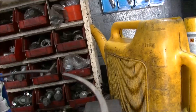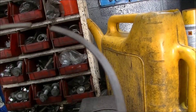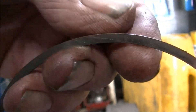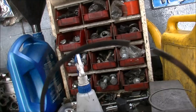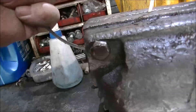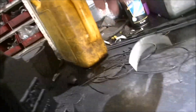This is the top ring. It still has hone marks on the side of there. You've heard me speak about the piston rings before when they flogged out - they get really sharp, you can shave with them. But this is really in good shape. It shows no evidence of getting hot and doing things like that. Another good thing to show: they've got still plenty of spring in them. If they snap like that, it's still good.